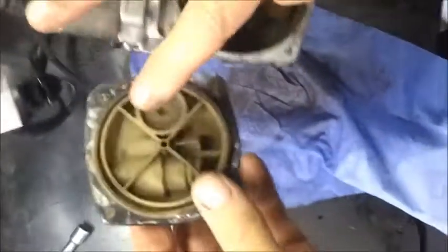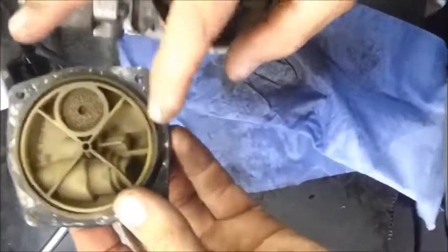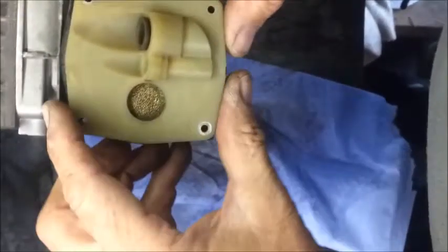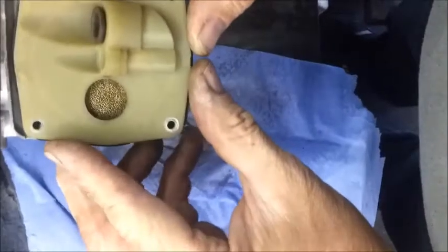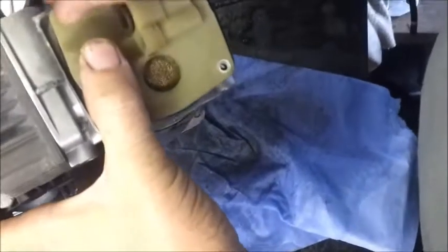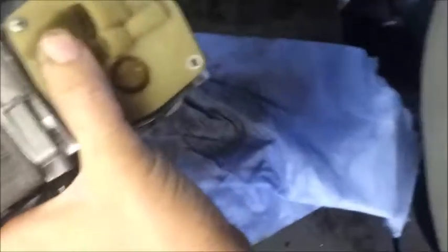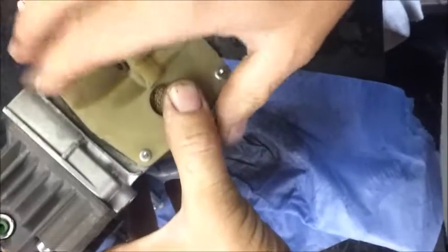If you actually removed the faceplate, then clean up the faceplate, remove any dust in the cover, clean up the gasket, and then replace it on the housing like so. And with your 3mm rivets, place all the rivets back in the cover. And using a rivet gun, rivet the cover back securely. And that is your piston seal fitted.